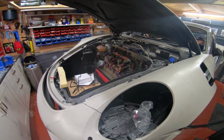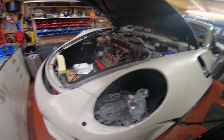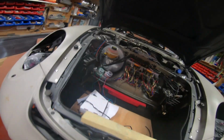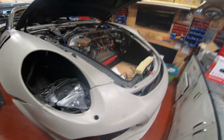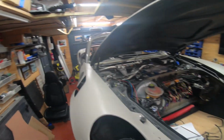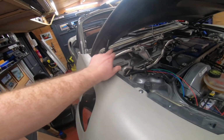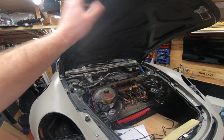It will save you a lot of time in the long run, because you'll know what it is, because by that point you might have sold your headlights or you might have sold your indicators and all that. So that's what you need to do. Just take your time when you start stripping it, it's not difficult. A lot of it comes apart very easily. Take the bonnet off. You can sell the bonnets for quite good money, to be fair, but don't get rid of your bonnet hinges, because you'll need them, because you use them for this one.